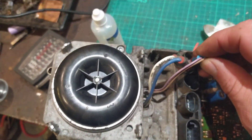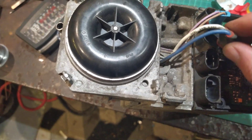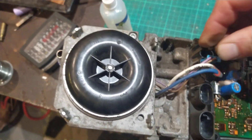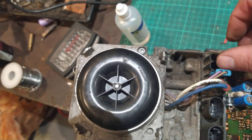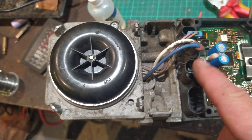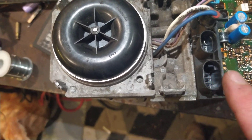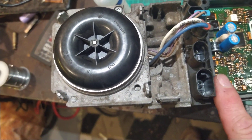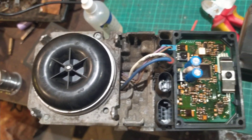Put these back in. That one goes in there — that's the glow plug, the thicker wires for the glow plug, pushes in. That one pushes in. You've got that other one there — that one is for your water pump, your circulation pump. That's your main power input, your positive and negative, which is always on, and your trigger. So on the new one I've just put on, it's pin one, and pin six goes to your fuel pump. There's two wires, that's it.